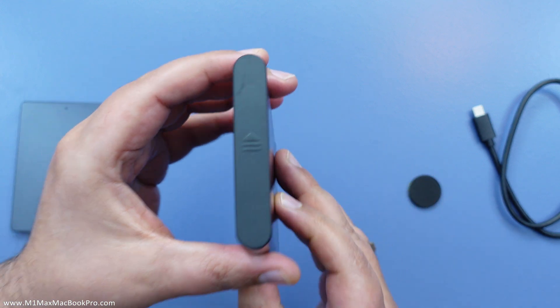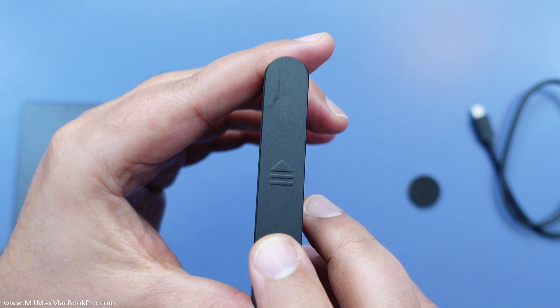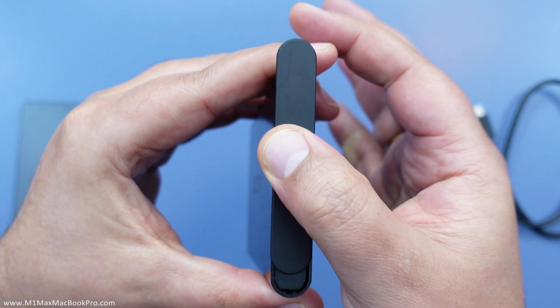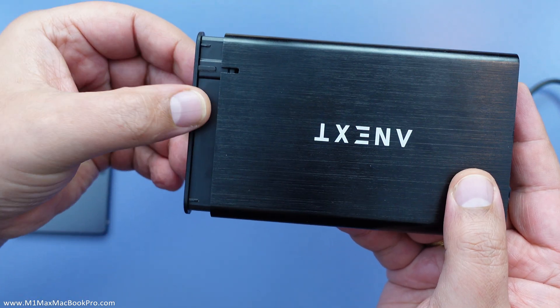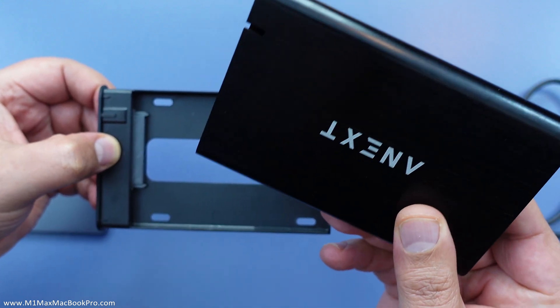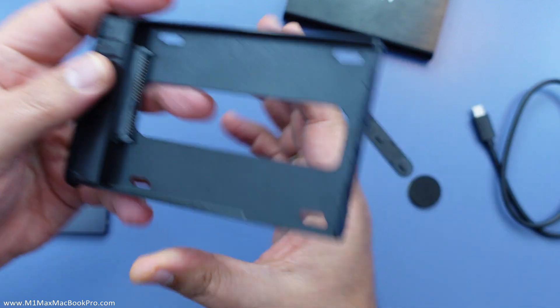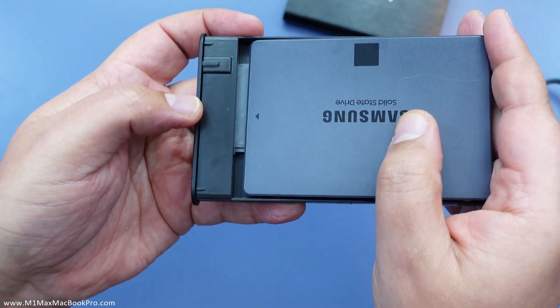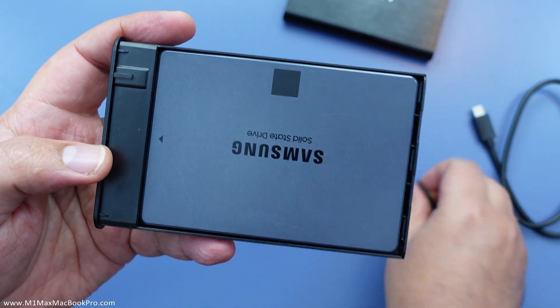This is a tool-less design, so no screws or anything, which is pretty neat. On this side there's a little arrow — just push down and then push forward, and that is going to release everything so the whole mechanism comes apart. Pull forward and the outer case will just come off. Inside we can see the SATA data and power connection. Simply get the 2.5-inch SATA drive, line up the data and power connections, slide the drive into the case, and push them in together. That's it — now connected, locked, and in place.